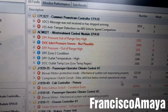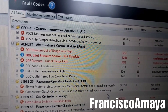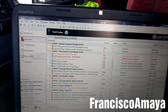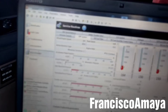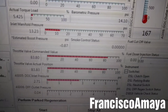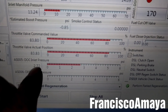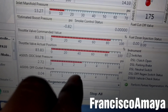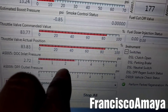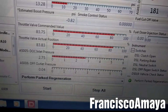In this case I want to show you the actual cause — how it looks when this code gets triggered and what you're going to look for. So with the engine on we go to the service routine here, and as you can see, the DOC inlet pressure is really high. That's what I talked about on my other video, and the DPF pressure is also high — more than 2 psi, which is extremely high.